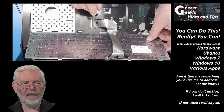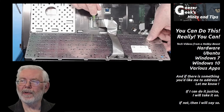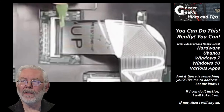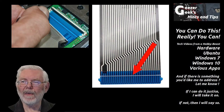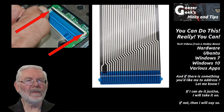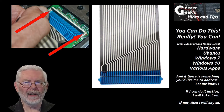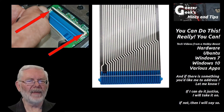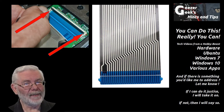Once it's released, flip the keyboard up and back gently against the screen, and then you have access to the cable connector. Gently use a plastic pry tool to lift up on the clamp holding that cable. Pay attention to which side of the cable is up — it's clearly marked on this one, but take note regardless. This clamp just folds up and then the cable can lift out. You'll see a stripe on the end of the cable and two ears that fit into notches in the connector. Pay attention to those details and the keyboard will go back in correctly.